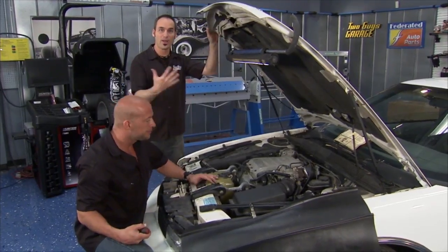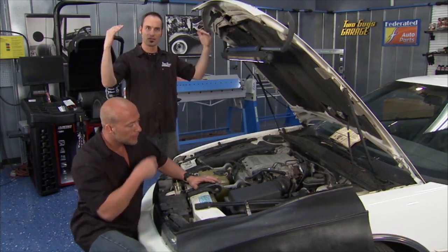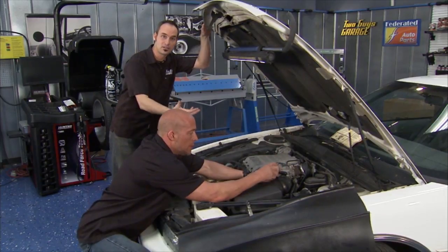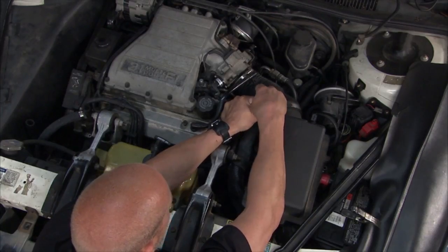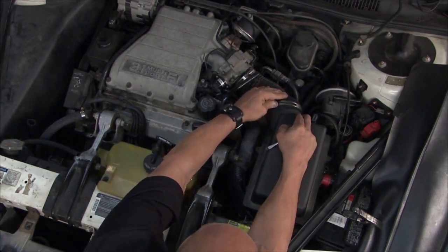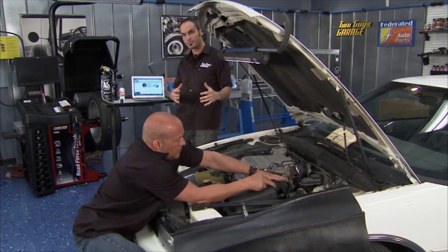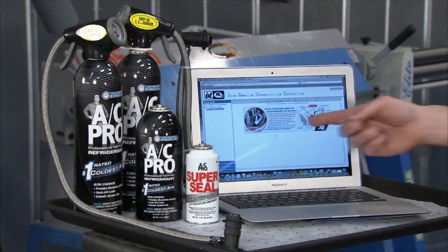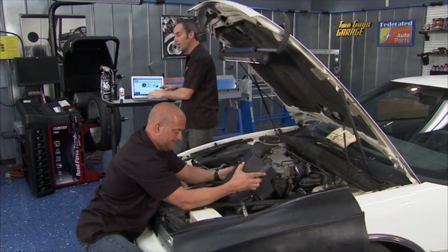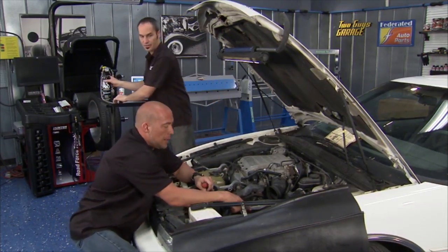Last year it blew cold, it was fine, he always had a cool dry shirt on. But over time, last couple of months, the cold started being not so cold anymore, and now it's just kind of warm. So we've probably got a leak in the system, so we can go through and repressurize and see if we can contain that leak or if we've got a major repair. Willie's going to dig through and access that low side service port. If you're not familiar with ACs, you can get on the AC Pro website, and they've got a low side service port locator for whatever vehicle you've got.